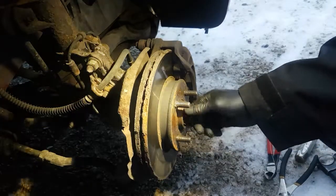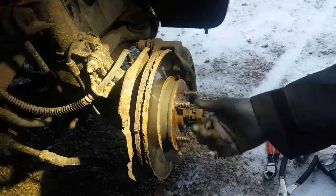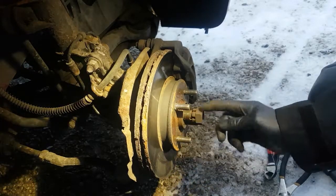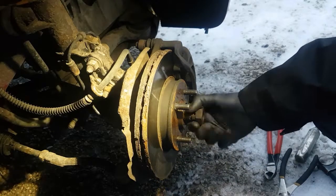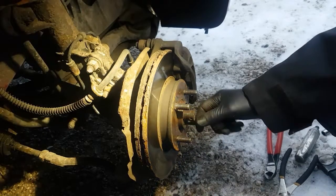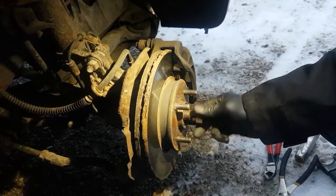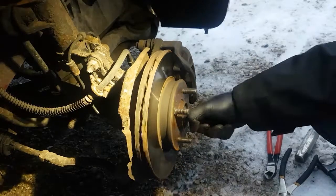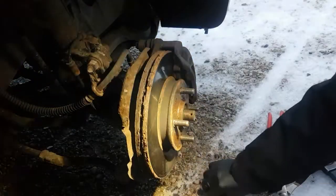I don't recommend hitting it with a hammer. If you're going to, put the nut on backwards and run it down. As you can see, it's not going to fit because I've never had to do it on this car. Run it down till this stud is flush with the outside of this nut, and then you can hit it fairly safely without wrecking, you know, the ends of the threads here. As you can see, this car doesn't have much of a taper sticking out that you can hammer on and, you know, mushroom it a bit without wrecking the threads, but this one's going to be pretty sensitive to it. So just be very cautious when you start hammering on that. You might want air tools kicking around so that you can run the nut back off after you're done smacking away at it there. Okay, there's that nut.